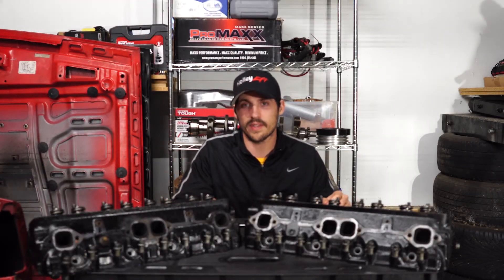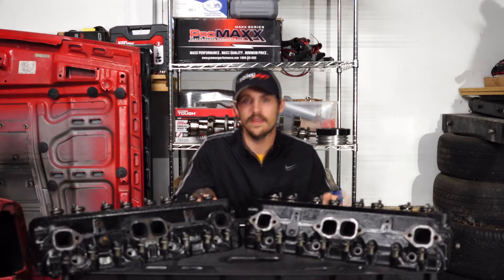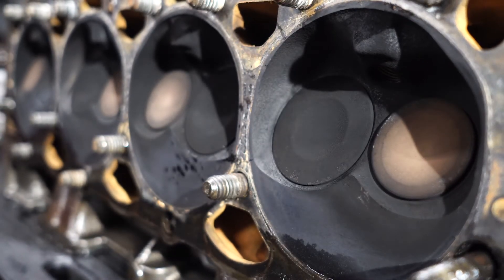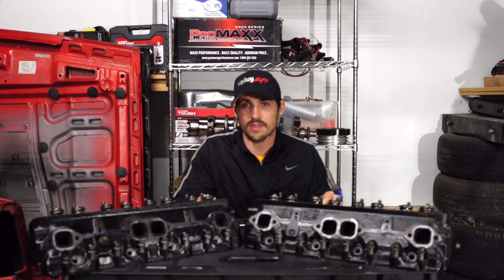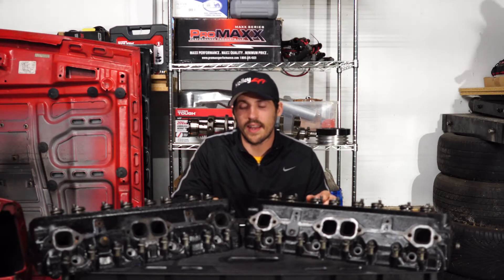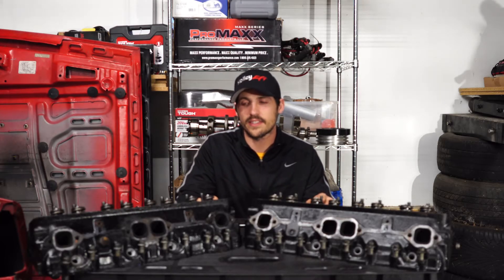Really, that's all the disadvantages there are to these Vortec heads. Now let me go over some of the advantages and tell you why you should be considering one of these for your hot rod. One of the biggest advantages guys love about these Vortec heads is the combustion chamber — these run a 64cc combustion chamber stock, which is a big upgrade from your old 72cc or even worse combustion chamber from those old heads. Another big advantage is the airflow; these flow a lot of air for stock heads — rated at around 170cc, which is a big upgrade for a lot of the old Chevy heads.